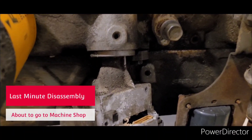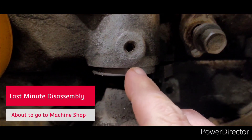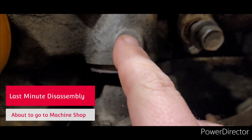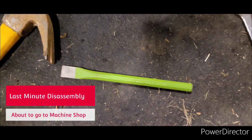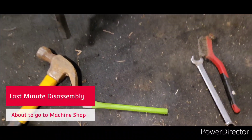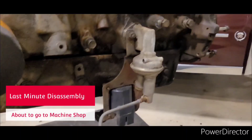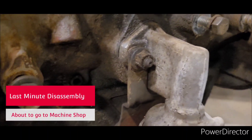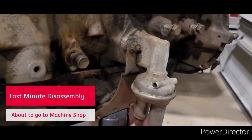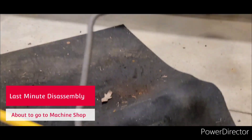The engine is upside down. I've got to take this distributor out. I'm going to put a mark on it directly in line with this hole on the side of the block. I'm going to use this punch to make the mark. So it should slip right off here — there we go.